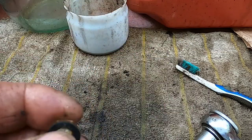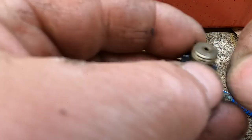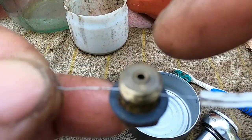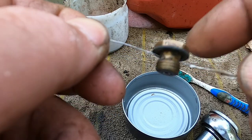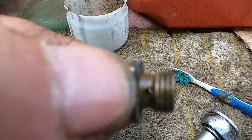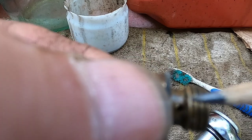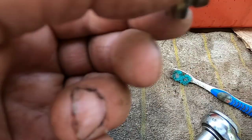Let's clean this out. See how that wire is going through — that was all clogged with debris. See through it now. See my finger right here — see the opening. Okay so now we can see through that. I'm going to hit it with some carb spray but I'm doing this off camera so I don't get it onto the lens.